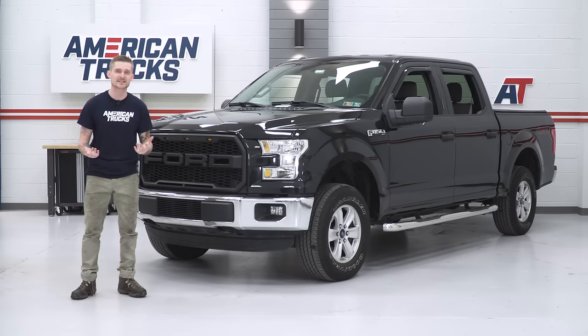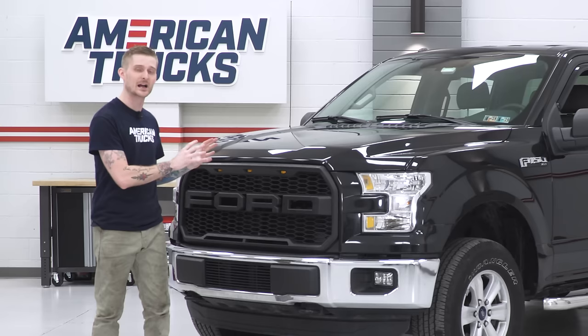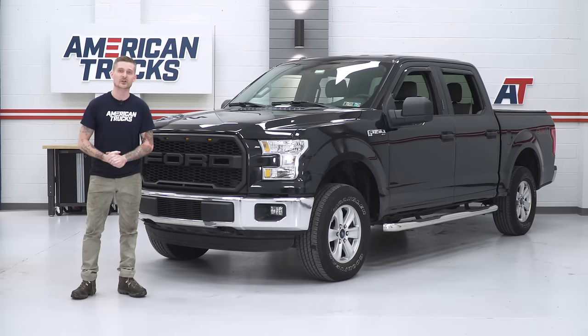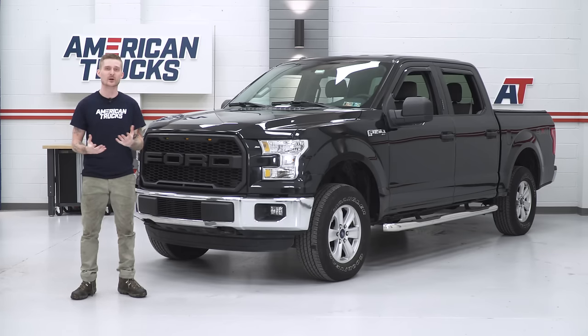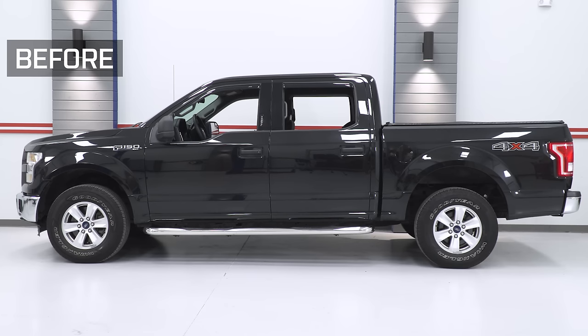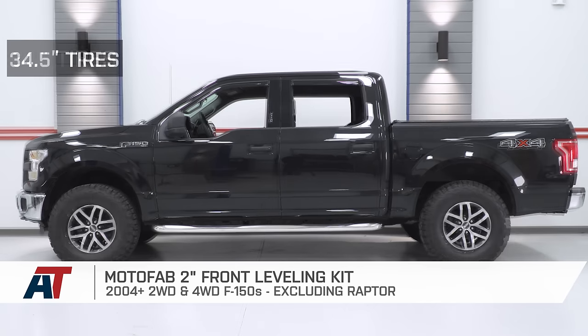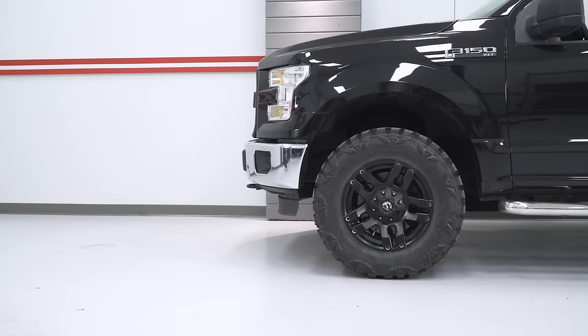Once you've got your wheels back on, go ahead and take it out for a test drive. Before you do that, if you have a four-wheel drive truck, make sure four-wheel drive engages and disengages properly to verify those vacuum lines are installed. You don't want anything grinding inside the shaft or hub. You're also gonna want to get an alignment because your suspension geometry will change just a little bit — your steering might be off slightly, and it's just a good idea to get that corrected. That should wrap up this review and install of MotoFab's two-inch front leveling kit fitting your 2004 or newer two-wheel drive or four-wheel drive F-150. Thanks for watching, and for all things F-150, keep it right here at americantrucks.com.